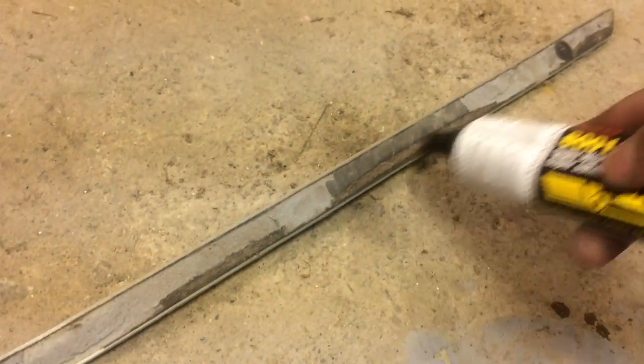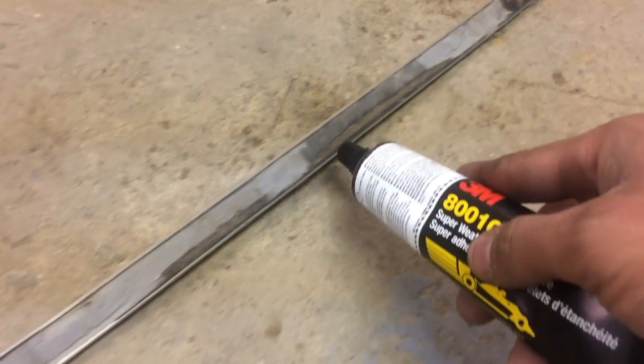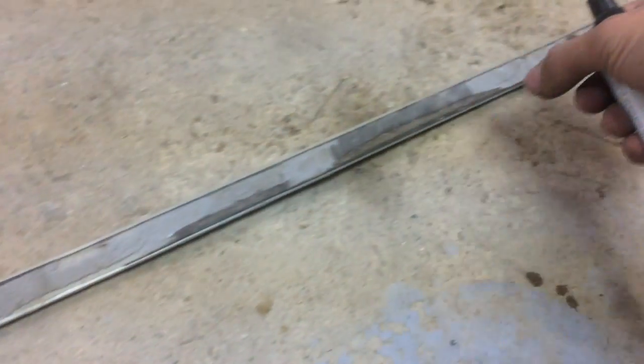You just take your trim molding, like this over here, and all you do is, this is straightforward. You see this stuff on your car, not in that bad a condition, of course. But you know what I mean? You've got double-sided tape here. Well, just take this and put a nice bead along here. And what I like to do with something like this, if it's that wide, is take a small, fine paintbrush, about that wide, and just basically brush stroke it on. Then apply it on your vehicle.